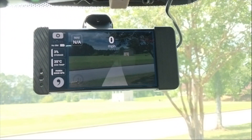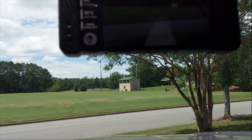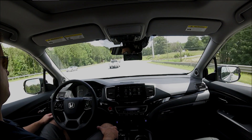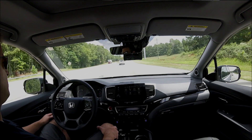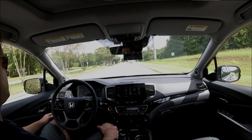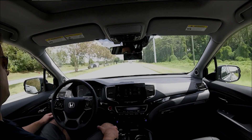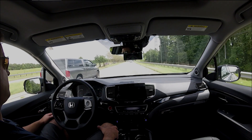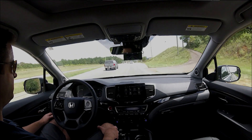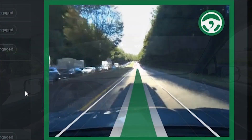When you're ready to drive, the camera is viewing exactly what is out in front of you. Now that I've shown you what the Eon is and how to install it, let's show you how it works. Here's my 2019 Honda Pilot with the Eon installed. Any Honda Pilot 2016 or newer with the Honda Sensing package is capable of running OpenPilot. OpenPilot works on nearly any road that has clearly painted lines or curbs, but the system really shines on the interstate. To activate OpenPilot, simply enable cruise control, and OpenPilot will begin to steer, slow, and accelerate, keeping up with traffic — very similar to active cruise control, only it does the steering for you as well. There's no need to continuously grab the wheel to let the car know you're paying attention.